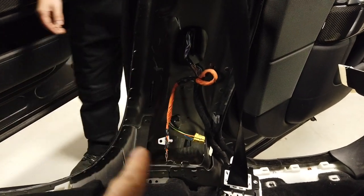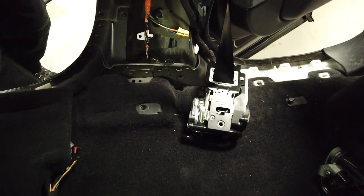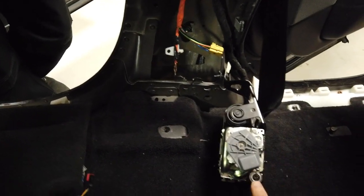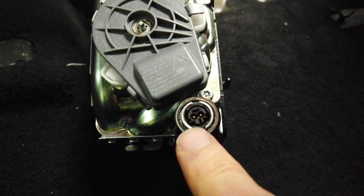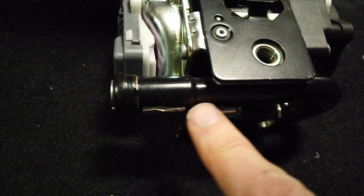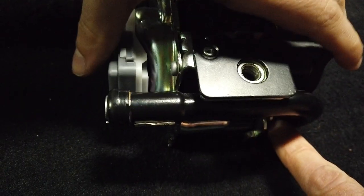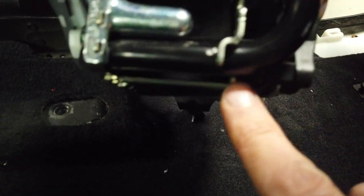You should have your seat belt mechanism here, which you can see on the floor there. Part of the seat belt mechanism has a connector here - let me zoom in. You can see this is the connector, and that fires - it's got an explosive charge and it fires some ball bearings.